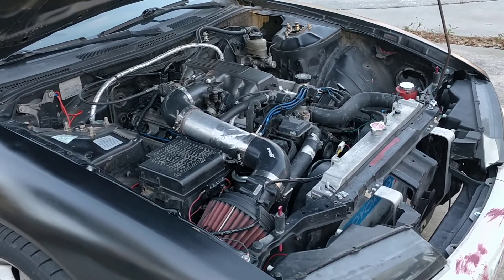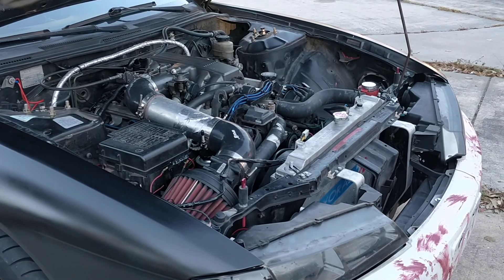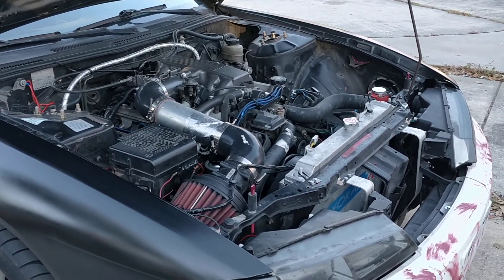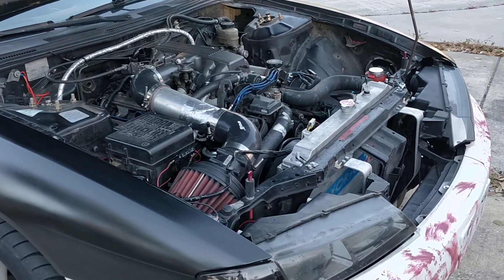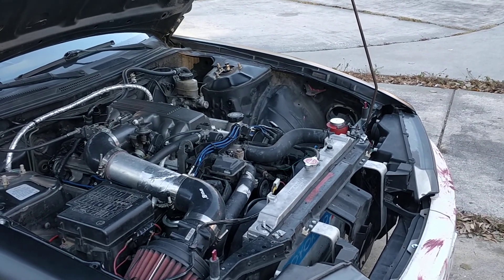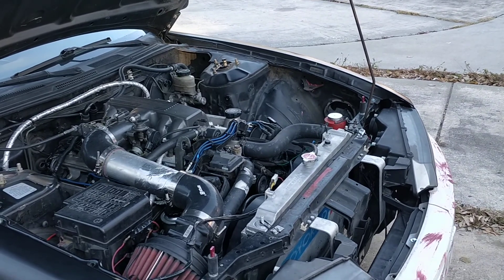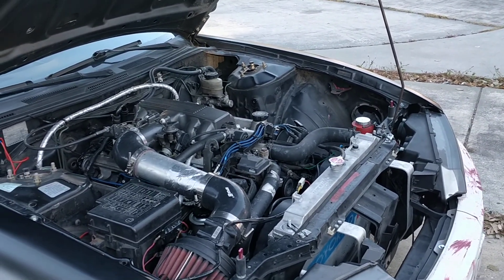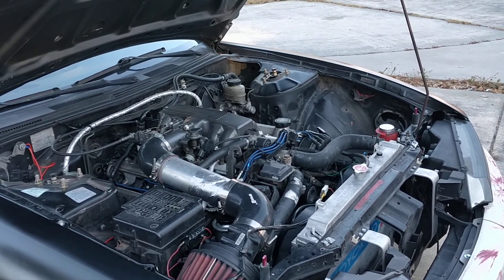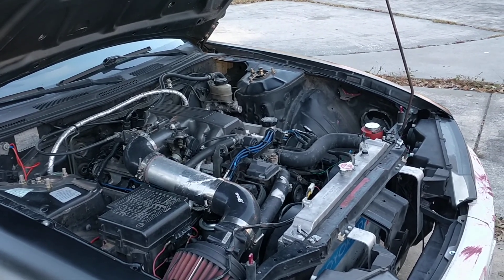Now it is time for a full teardown. I will be going with the Audi R8 coil packs, coil-and-plug setup, with a micro squirt controller — not to be confused with the mega squirt, I am going with the smaller micro squirt. I will be doing a video on how to assemble that all together for the 1UZ. I will be using a 2J trigger wheel on the crank, omitting the cam sensors, and running batch fire wasted spark with 4 ignition outputs.